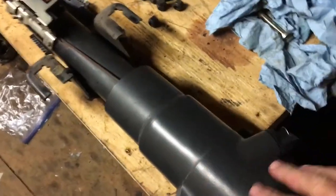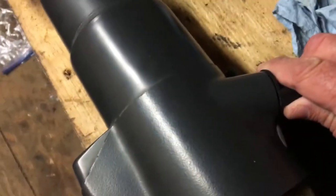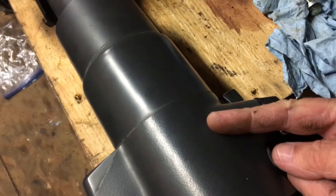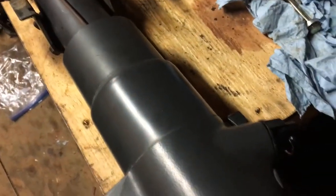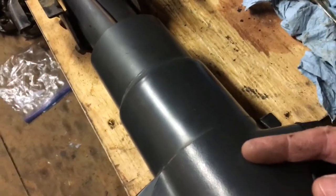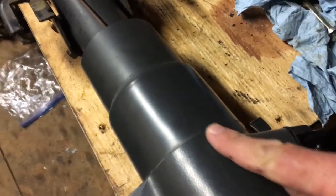What I did was I got into the steering column, got to this lock cylinder. The way it works is that when you turn this key, there is a gear right about here. This entire lock cylinder slides into that gear and mates with the gear. It's got a little fork — just a key mechanism so that it engages with that gear. And as you rotate the key, the gear turns — it's a pinion — and it moves a rack, a metal rack, back and forth. It's sort of like a rack and pinion steering.